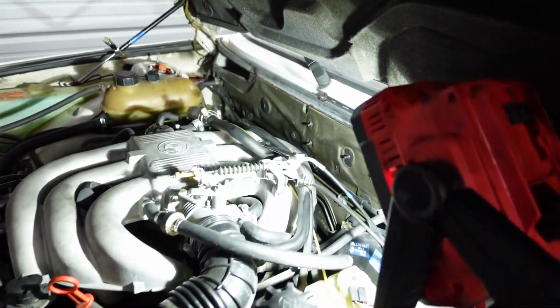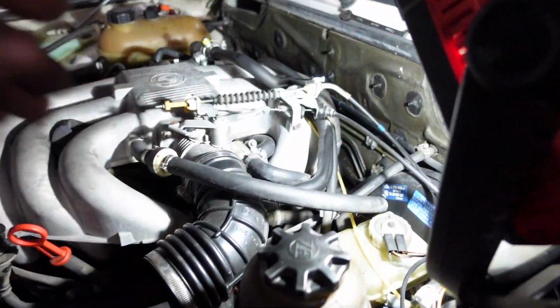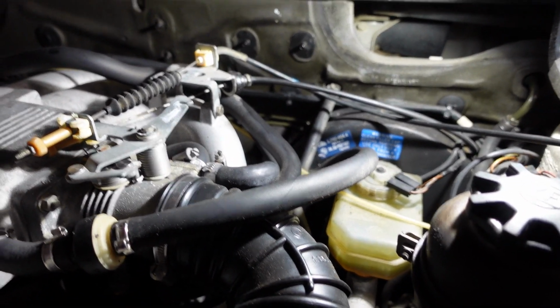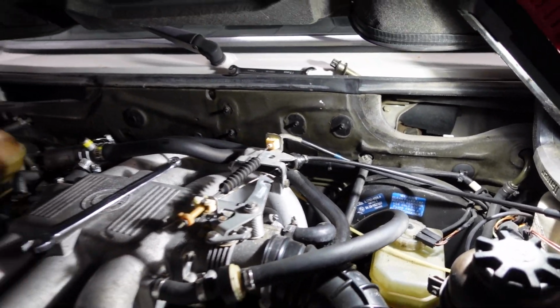That bolt was a complete nightmare. Couldn't get it from the bottom, so I had to come from the top. I pushed the transmission upward so that it tilted this way, the engine and transmission this way. Gave me enough room to come from the top. Of course, you can't fit a socket or anything in there, so I had to use a long 11, which fits snug enough. Went in, turned it quarter turn or less each time until it came out. It was an hour and a half, maybe 2 hours of my life on that one bolt. So it is what it is. That's M20 life for you. So let's keep going. Let's try to drop this transmission now.